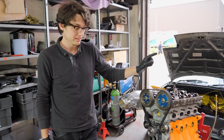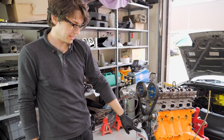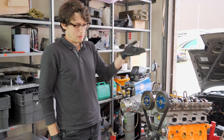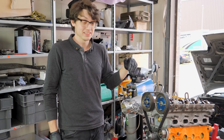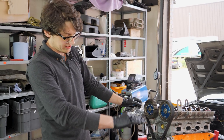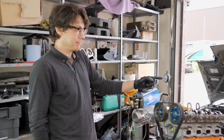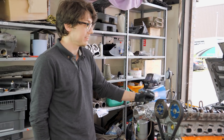We've just found true top dead centre using a piston stopper. We've put our little marker on top of the centre on our degree wheel, and we're going to do all of our testing on lifter one on intake. I've rigged up a bracket contraption for a dial indicator — it came from a bore gauge. The rod is on our target bucket. We're expecting to turn this and if our eyeballing was correct, the specs say we should see max lift at 110 degrees. If that reads 110 at max travel, we've got it right; if not, we'll adjust until we do.